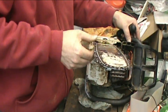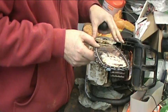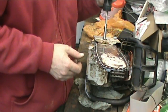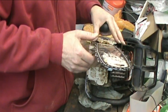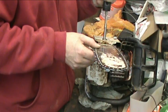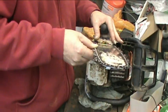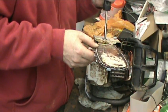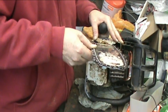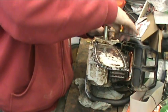Going back and forth a couple of times to get the kinks out of it, if there are any. Being this is brand new, you usually tighten it a little bit tighter than normal, because my experience with new chains is the first time you run them they really stretch real easy. Any time you put a chain on there it's gonna wear and it's gonna stretch. You're gonna get slack in it, but new ones seem to be worse. So yeah, I'm running it a little bit tight. Eventually it'll wear down and we'll get more slack in it.